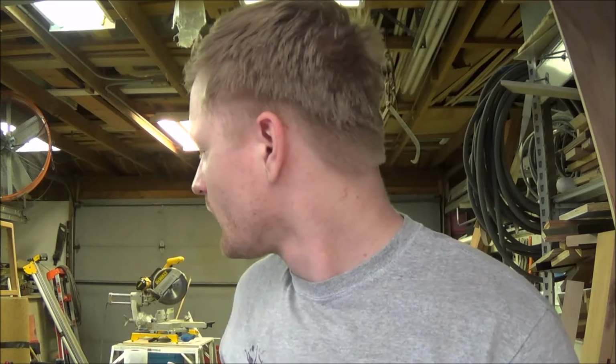So I don't know how much of that has to do with the cleaning that I've done. I actually prepped this pretty well, so that might have something to do with it also. But it seems like a much cooler weld, in the sense that you don't really run the risk of burning through, as I did with the other one. So I don't know if there's just less flux in it or something like that.